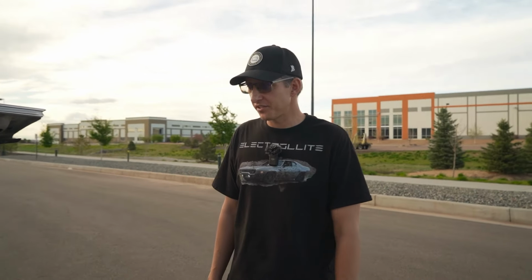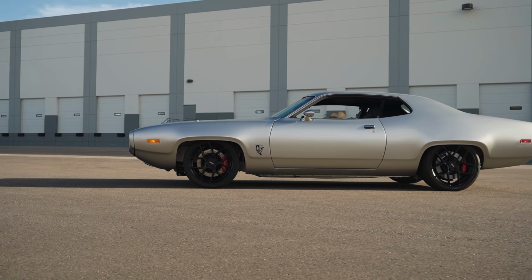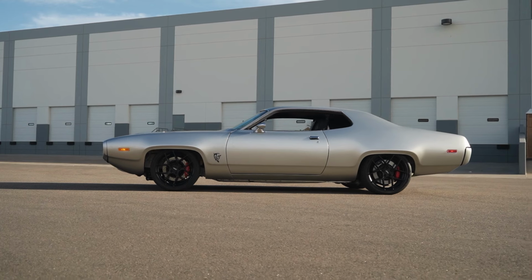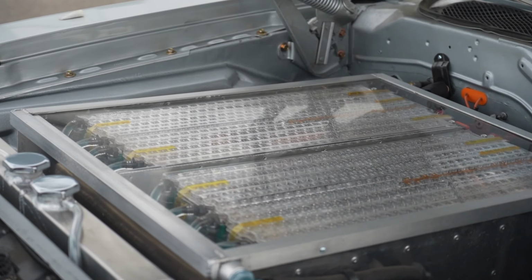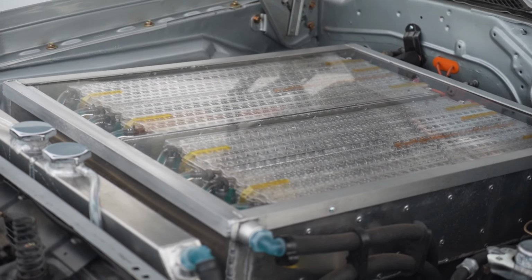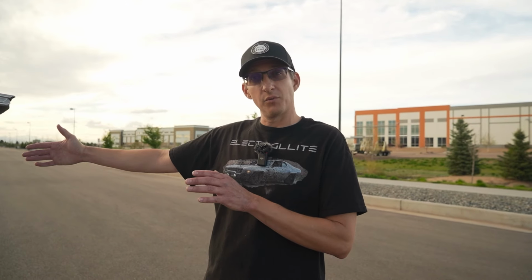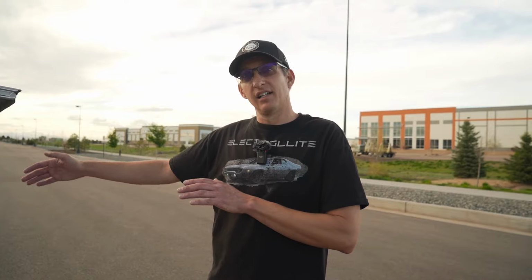So now I've got the race mode installed. How much does it weigh? It weighs 4,358. Okay, so it's pretty heavy. A big block car was about 4,000. But it's 600 pounds lighter than the Tesla I got the parts out of. And the rear batteries and motor give it a rear bias on the weight, so it's 55% rear weight now. Really? So it completely changed the handling of the car.